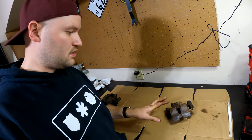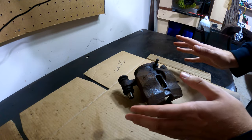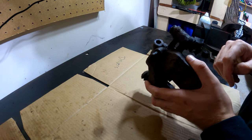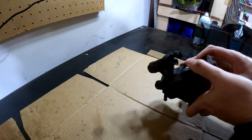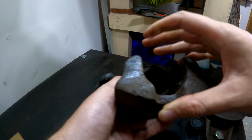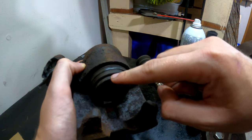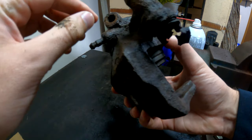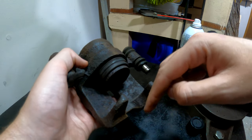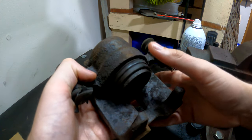Alright guys, we've got these calipers cleaned up as good as they're going to be for the time being. They're obviously out of the car and we are ready to start disassembling them. We just have to take everything off so it can be cleaned up properly. The bleed nipple, this is where the brake line goes in, this is just a boot that needs to be removed, this pin should slide out, this boot needs to come out, and then the piston needs to come out — which was seized on the other one. Typically you would just put a compressed air line in here, jam it in, open some air up and it'll pop out. If it's seized we might have to put some penetrating oil in around, pry on it a little bit. Alright, let's dig into it.